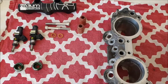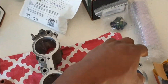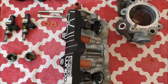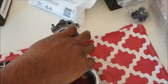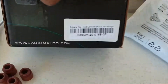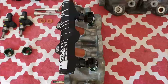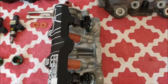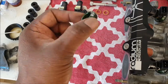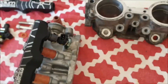Hey guys, today I'll show you how I did the fuel rail setup. I already did one - you can see here - but I'll go through the second one. Once you've got the TGV and the same Radium kit, which is 20-168-02, for doing the Subaru top feed conversion, all you have to do is get these injector seats. These ones are 22 millimeter if you've got the TGVs.